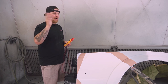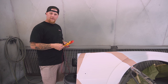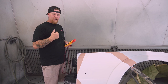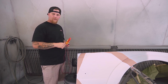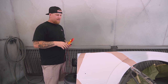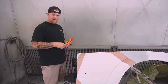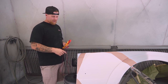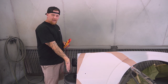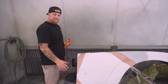So we're going to be shutting the lights off as best we can in here, getting out a heat gun and/or a blow dryer, and we're going to just dust this. Dial your needle all the way back and choke it. And I'm using a 1.3 instead of a 1.4. The last coating, the very last one of the four, is water-based material, where the other three were solvent-based. But it is conductive, so you gotta make sure your leads are completely covered. We are going to tape these and make sure that nothing of this material touches any of these wires on the backside.